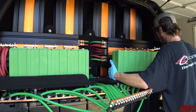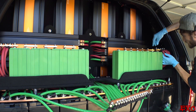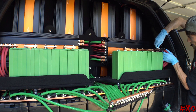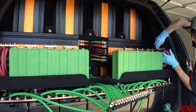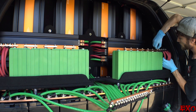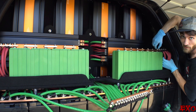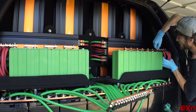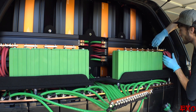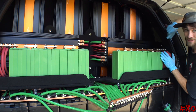I've got about a half inch left until I hit the barrier — the stop. All right, I'm there. She's positioned and she's centered. Let's get it back in here. Make sure everything's negative to negative, positive to positive. There will be no spark because our AGMs are still in the circuit, and our capacitors and our amplifiers were already charged up about five months ago when we originally installed all this gear.